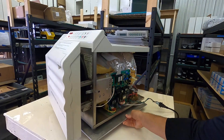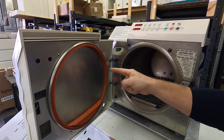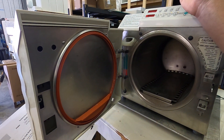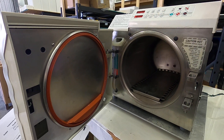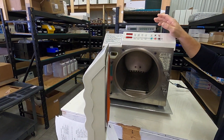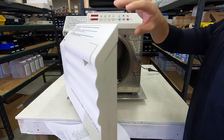So if you're running a cycle and you haven't changed your door gasket in a while, steam will be leaking out during the cycle. That would cause a power interruption, triggering the E001. So if you're getting the E001 error code and you haven't replaced the door gasket, that will be the first step.